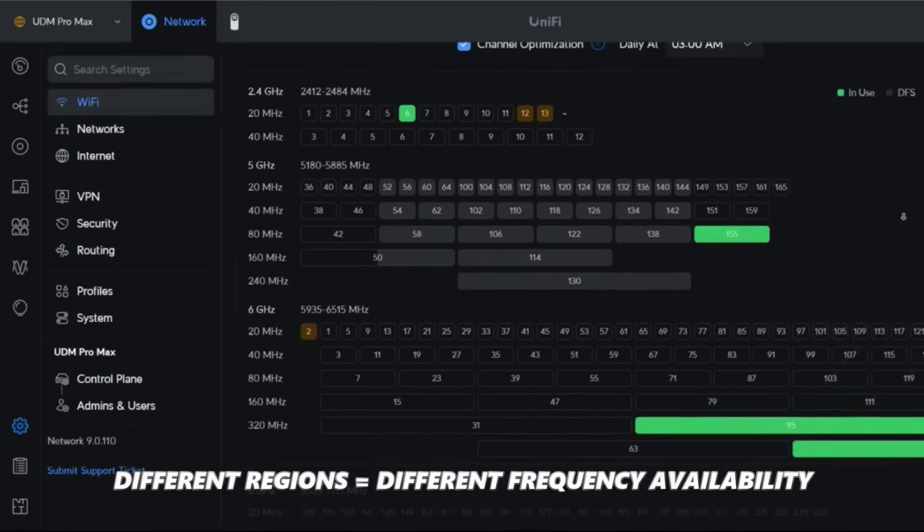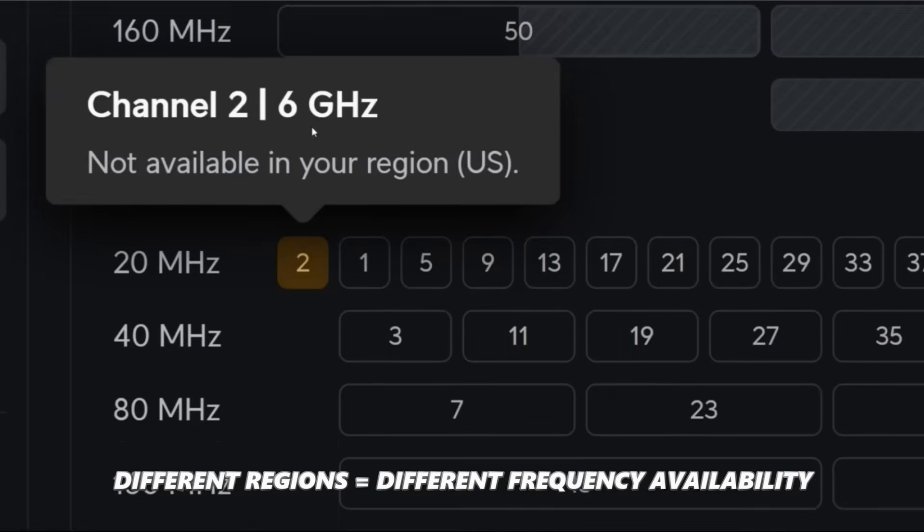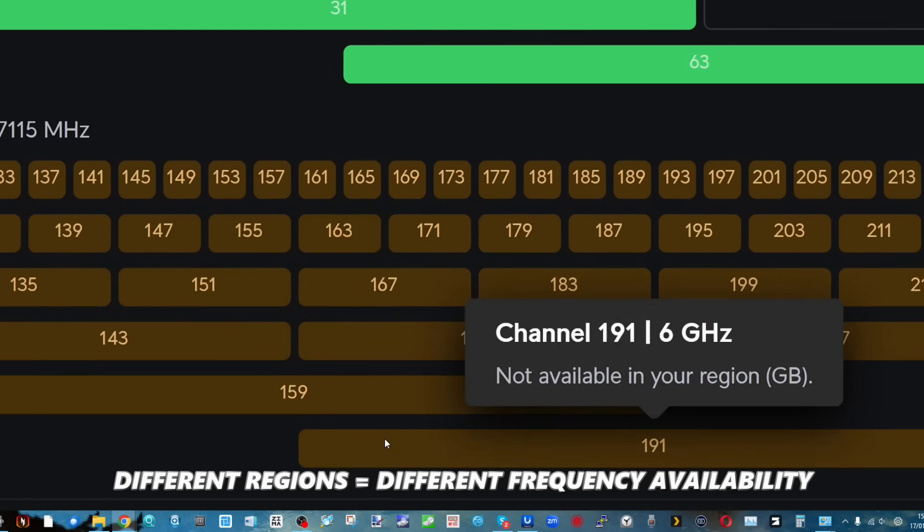And of course, the other question: if you don't currently have Wi-Fi 7 in your network environment, should you upgrade to Wi-Fi 7 right now? Kind of. If you're going to upgrade your wireless capabilities — whether via USB, M.2, or PCIe — in terms of future-proofing, you've got nothing to lose. Power consumption is more efficient, and you're opening up multiple bands for when the time comes. However, the 6 gigahertz band is still largely locked out right now, with frequencies only gradually being opened up as they're released from military and emergency services use. So you may have a Wi-Fi 7 router and affordable Wi-Fi 7 client devices, but a lot of that band is still locked out.